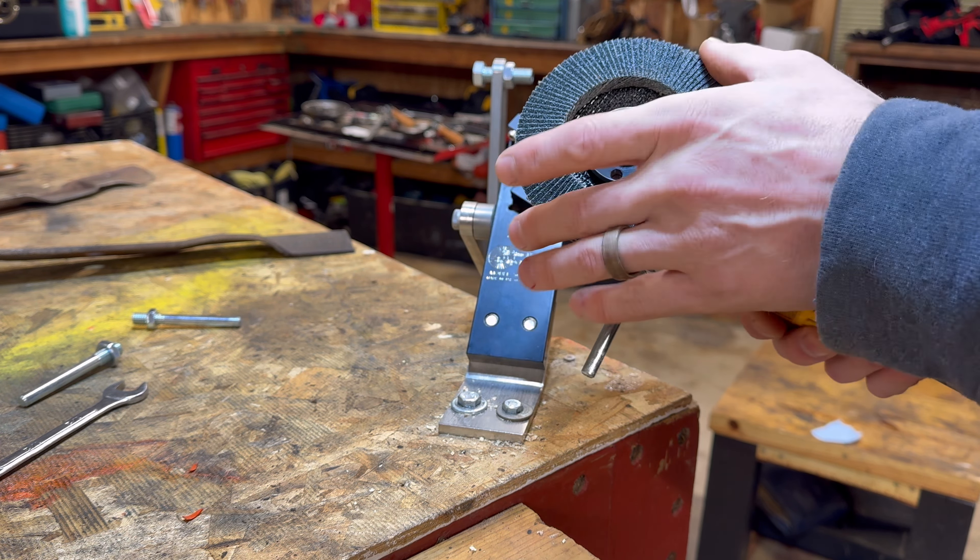Hooked up to that I'm using a flapper wheel — a 60-grit flapper wheel, which is what I prefer on my lawnmower blades. You can use something more aggressive like a 40 or an 80, whatever you want to do. But I would stick with the flapper wheels. The big hard cutting wheels — you can do that, but you might have a chance of nicking the blade when you're really pushing in and grinding too much off, so the flapper wheel's gonna be a little nicer to you.